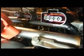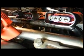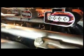The next things that need to get removed are all the coil packs and the spark plugs. The specialty tools are to help get the coil packs unplugged from the wiring harness. On a lot of B6 S4 wiring harnesses, a lot of the easy relief clips on the back are broken. So I use a hook tool — generally you want to get in there with the hook tool, get just above this little lip, and pry this tab up. This tab is what's holding the coil pack into the wiring harness, and once you relieve it the coil pack will slide out.